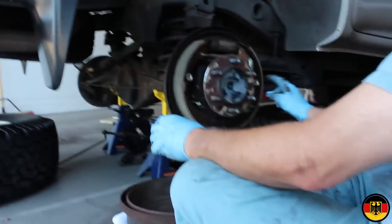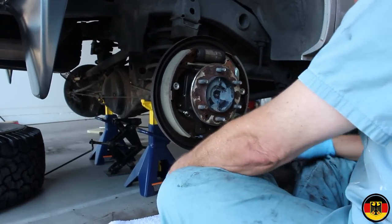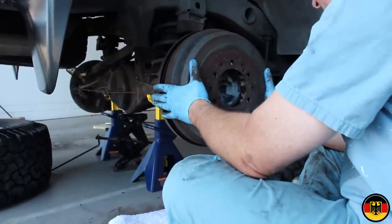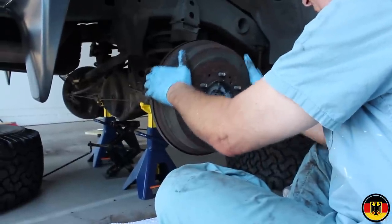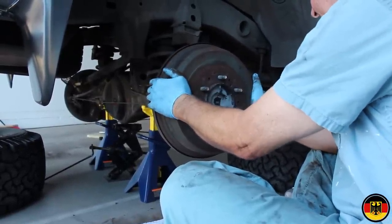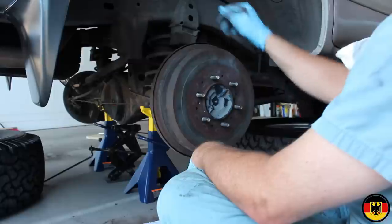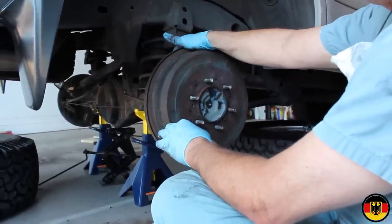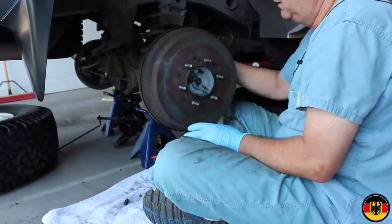So again, I have brand new shoes, drums all clean. I Scotch-Brited it out slightly to make sure it was clean, and it's smooth inside. So this should fit right on, and it does. I'll put that on there. I'll make sure that it turns freely, and it does. So then I'll start adjusting from the other side till we get it adjusted, and I'll explain how to do that next. Okay, I've reinstalled the drum, and I've pushed it all the way down, and I'm ready to adjust